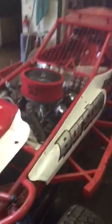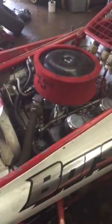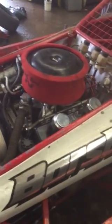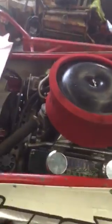And this is the tarmac car. I'll tell you what the differences are. There's not a lot of difference between the two cars. They've both got small block engines in, Chevy V8 engines. This is a 427, which is about 7 litre, and the other one's a 434, which is about 7.5 litre. The engine on the tarmac car is about 7 inches further forward than on the shale car, because you want front braking on tarmac. So bigger discs, bigger calipers, and bigger pads on the tarmac car for front braking.